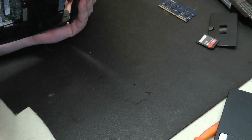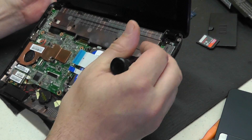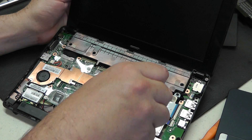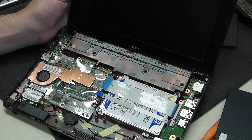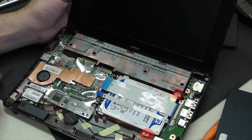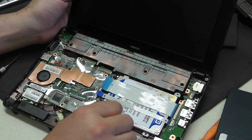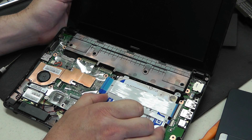And then we will take out two screws that secure this hard drive into place — so just two more screws is all we have to take out. And we will be able to basically slide our hard drive back a little bit to ease it out of the netbook. Only two screws to take off of the hard drive. I'm going to mark those here in red — those are the two areas you take the two screws out. And we can slide the hard drive back now; the hard drive will slide back slightly out of the SATA slot.